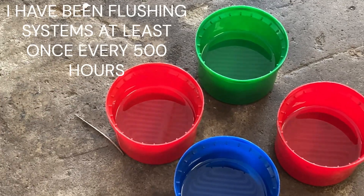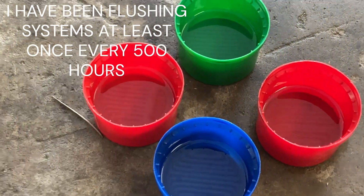Clean your fuel injectors when you do this. Every time I've done this so far it does run better afterward. This is flushing out the flow divider — make sure there are no particles stuck inside, get everything out of your lines, then pull your fuel injector apart and clean it up real good. Make sure there's nothing stuck in it. Fuel screens everywhere — the important one is the fuel screen inside the throttle body right here. That's your final catch; make sure that one's clean.